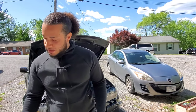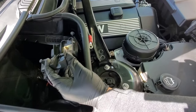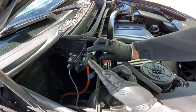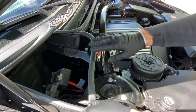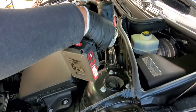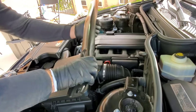To remove the two bolts on this engine crossbar, you first need to move the battery terminal out of the way. Lift the little piece up — it kind of slides on there — and it comes with a little black piece. Pull up and it comes straight out; a small piece falls out so make sure you catch it. Then take a half-inch socket and remove the bolts from the crossbar. Remove each bolt and the crossbar should come straight out.